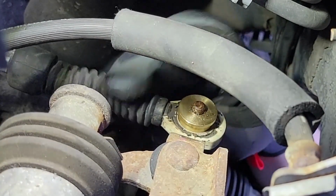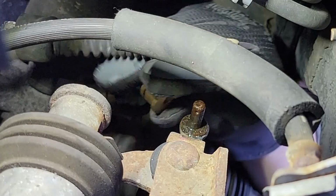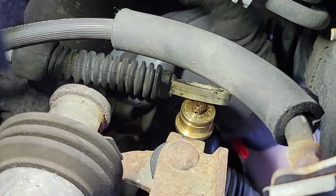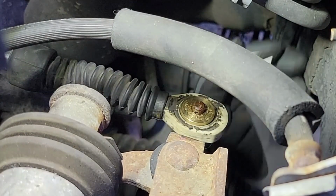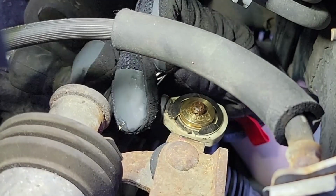The bushings have a groove cut in them for the C-clips, so face them outwards, and then we will go ahead and install both the clips. If you have some gloves on, you can install them by hand. They slide on pretty easily. Finish this side up with a pin.